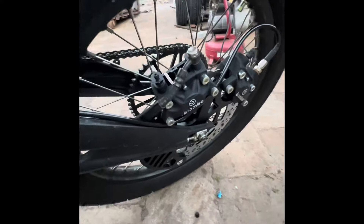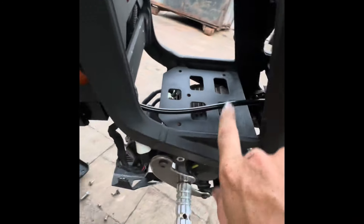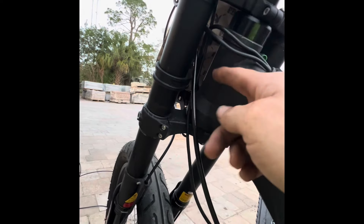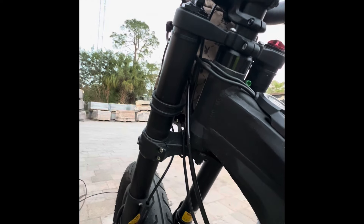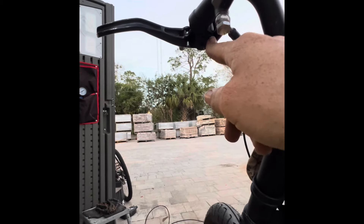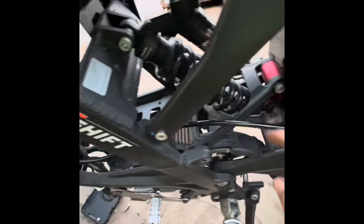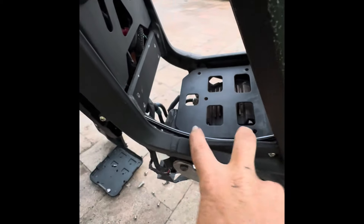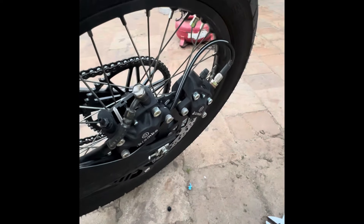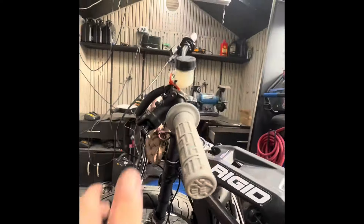I've done a bunch since then. I had to undo the battery tray, the back portion, the skid plate, and undo a portion of the fork so you can slide the cable out to get the old brake off. This is an HC1 13mm hand master. I ran my cable down through here, tucked close, ran it back like this, and then up and in.